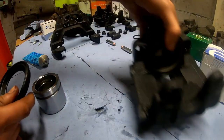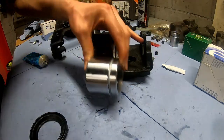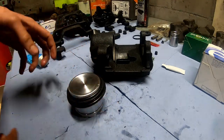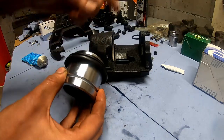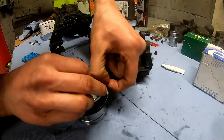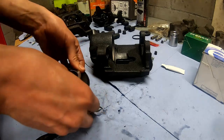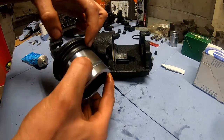Put the ring into the deepest groove in the caliper — just fiddle it in and make sure it goes in straight, then run your finger over it to make sure it's seated well. Next, take the piston — the gap faces to the outside, and the rubber will sit in that gap later. But first, do this dry: from the back, put the rubber over the piston just a little bit over the edge. The reason you do this dry is because if you grease it up the rubber won't stay in position, and you need it there to get it into the caliper.